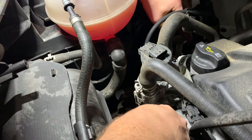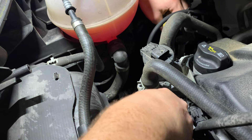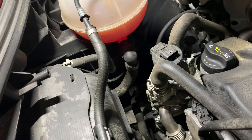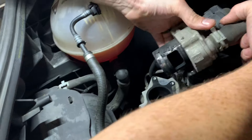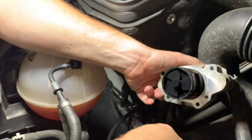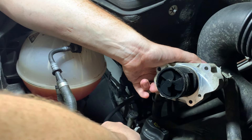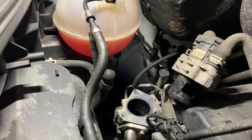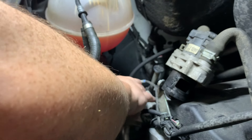Mind the temp sensor on the back side of the valve, but just slowly work it up. Once it comes free, work that valve out and lay it back — you'll see it is really, really well carboned up. There's your old gasket on the body; just throw that off to the side. Take a paper towel and stuff it down into the bore inside the body.